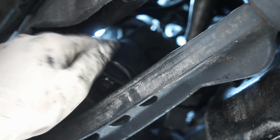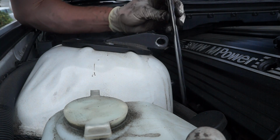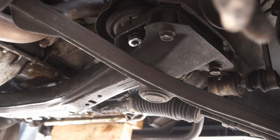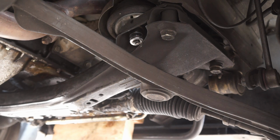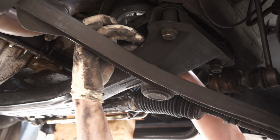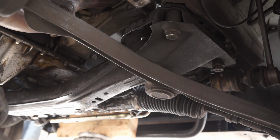We got to get the bottom nut and the top nut all the way off, and then we're going to basically repeat the same procedure, jack it up, and then get the new mount lined up. Unthread him all the way. There we go. Now this one's going to be a little fun because my 17 socket got stuck on the bottom mount bolt. So I'm going to jack it up, and as I'm jacking it up, I'm going to take that nut off too, and then jack it up even more to get the rest of the mount off. My socket back. You thief. There we go. That one came out a lot easier.